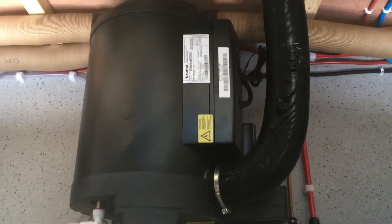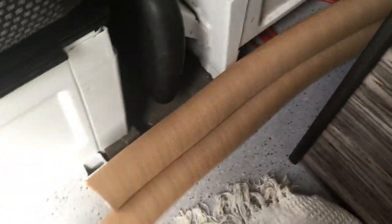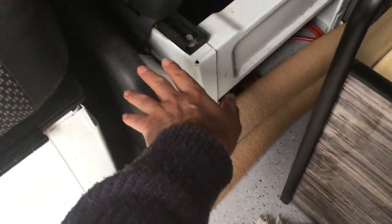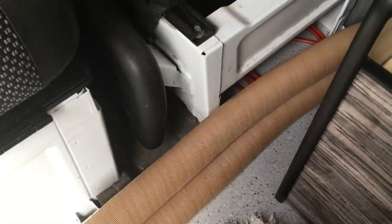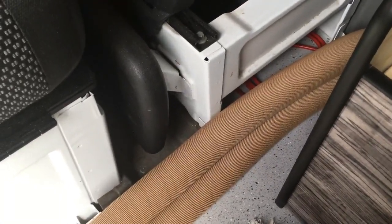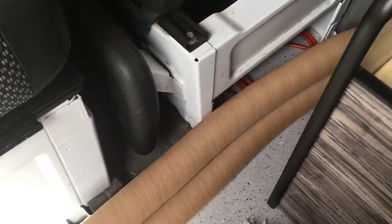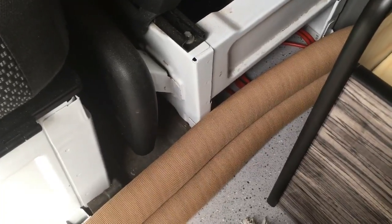Here's the Truma boiler installed underneath our bench seat, and here are the two ventilation ducts coming off the left-hand side of the boiler. They go through the side panel of the bench seat — you'll notice there's our dropout vent — and then they come round this gap here. I'm going to box all of this in, but this first duct is going to turn and I'm going to have a vent between the two seats blowing into the cab, because the cab area has by far the most heat loss with all that single glazing, so it's really important to keep that area warm, otherwise it's just going to suck all of the heat out of your van.